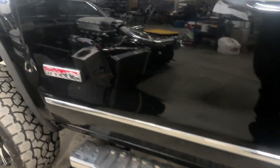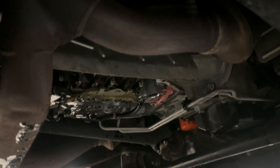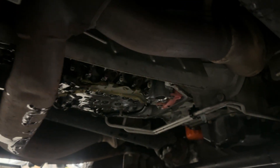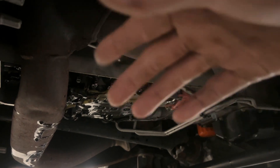So I come over to Nigel's, pulled the pan off of it. It's pretty easy to do on these Chevrolets. Pretty easy — get the filter off, pull all your pan bolts out, you gotta wrench two of them out, you can slide it out with the exhaust on it. I got a new wiring harness — right there in the pan — I washed it out, got a new filter, unboxing new gasket. The thermostat on the other side is about $380 at my cost on parts. So I'm going to show you all how to take this wiring harness off, replace it, and put everything back together.